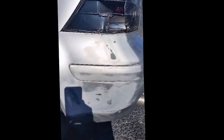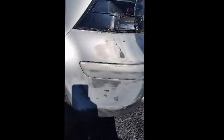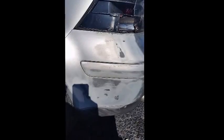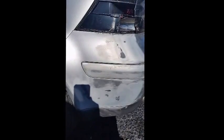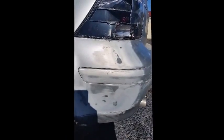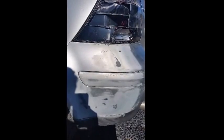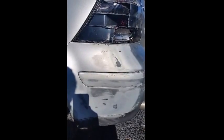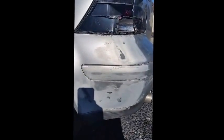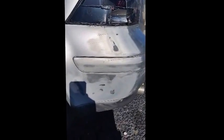The sanded area is becoming kind of a light blob. I was originally just going to clean it and get rid of the powder — which gums up the finer sandpapers — but wet sanding is also supposed to be a great idea. The principles are that water and soap act as a lubricant, and also as a cleaner so you're not polishing in dirt or old paint. I'm going to wipe off the car first with some soapy water and then get some wet sanding in to make the surface smoother.